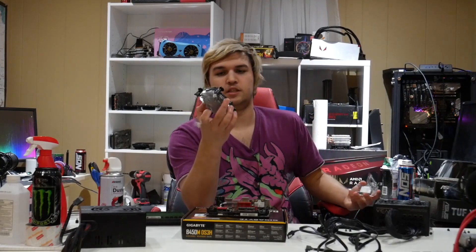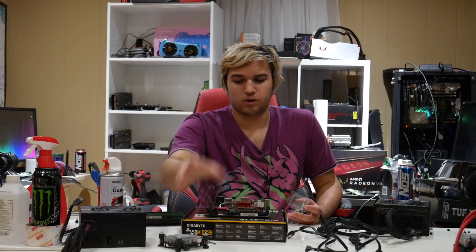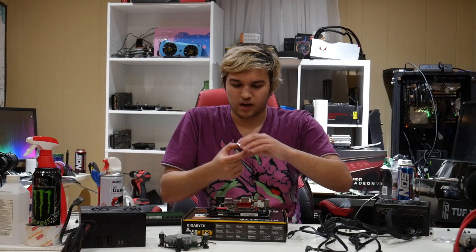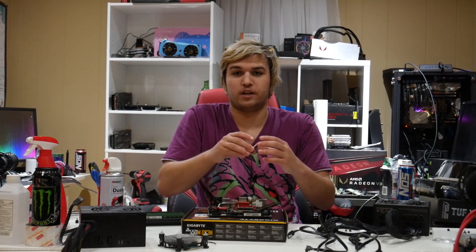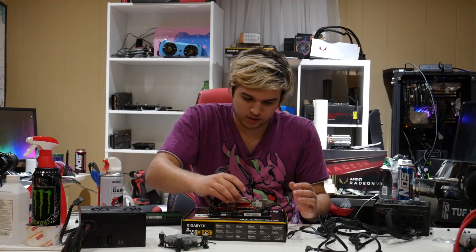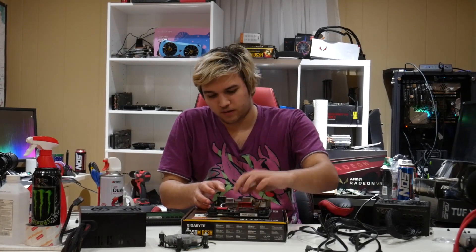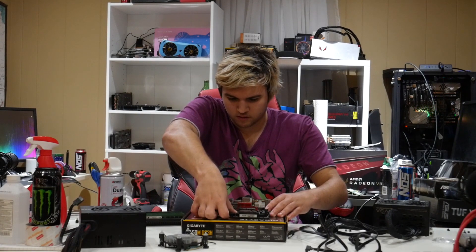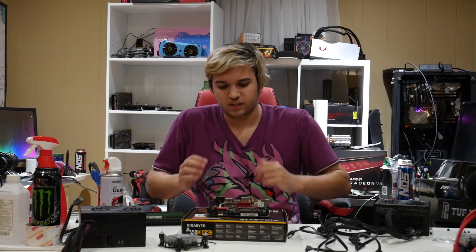And for cooling, it's this. This is an abomination of a cooler for an abomination of a PC — this actually came with this CPU, and wow, this is disgusting. But if it works, it works. So this is a plastic Intel install. Though I hate working with LGA boards — I do not like pins on a socket, they are too delicate. AMD CPUs just drop in, easy peasy. This is a little harder. And then this requires an uncomfortable amount of force. And there we go — our CPU is installed. 4130T in our Z97 chipset.